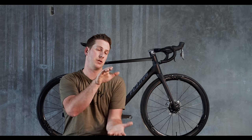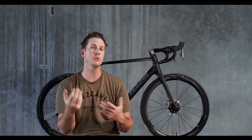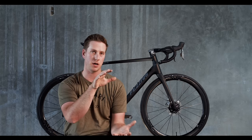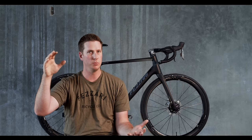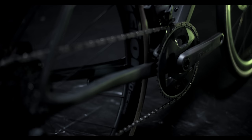We're able to get riders comfortable instead of just relying on a big tall head tube. We'll still keep a little bit taller head tube for handling, but if that head tube gets too tall, we reduce handling. So we run our head tube lengths and stack heights in that middle range — not a super endurance bike, but not a full TT crit racing bike. We do that on purpose to keep the lively handling and cornering, while really having that all-road feel. The other thing that keeps the bike really sporty is our short chainstays at 410 millimeters, which allows the bike to be really snappy underneath you, corner with confidence, and when you sprint it's really going to take off.